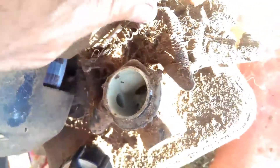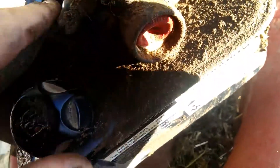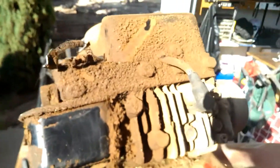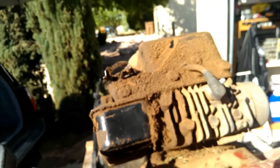That's a positive note. Over here in the carburetor, the throttle area and the springs are all jacked, and something's going on up here. The governor seems a little flimsy inside, so we'll have to get the lid off and take a look at that. This one's a beast — it's going to go to the power wash, pull the shroud, and then power wash again down inside.